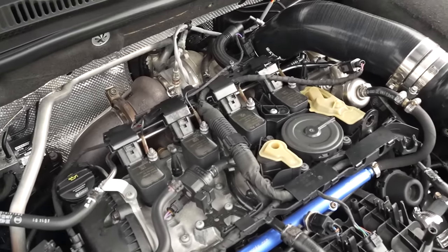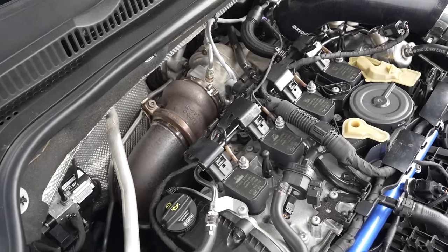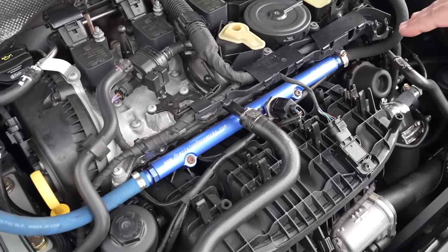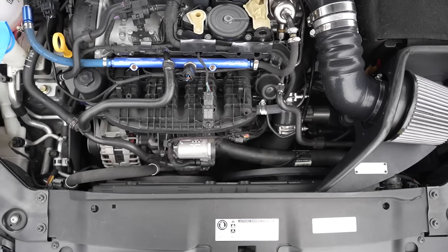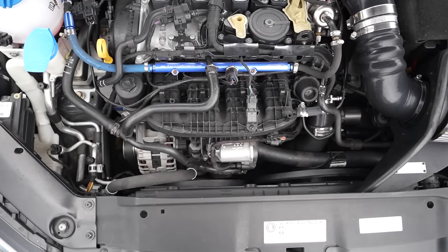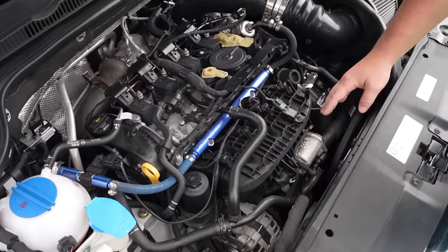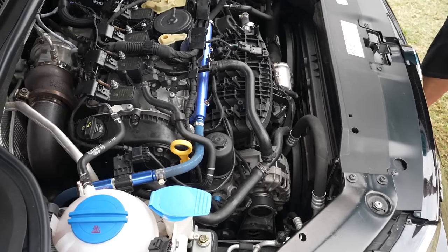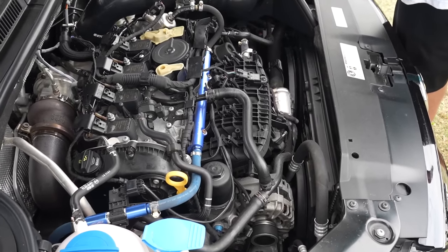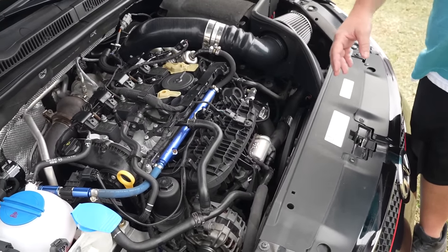We have a DBV2 IS38 hybrid turbo. This is their V1 with a triple ball bearing housing. We also have MPI installed on the vehicle. It's not quite activated yet. We're working with tuning on that eventually. And essentially the turbo is literally backwards. In order to get it in there, we had to reroute the entire coolant system to be like the seventh generation Golf R and GTIs. The difference is there's a lot of mechanical items instead of digitally controlled valves.